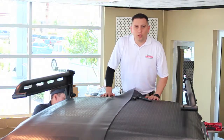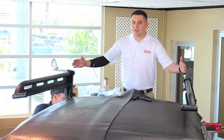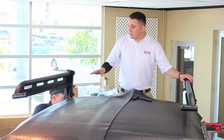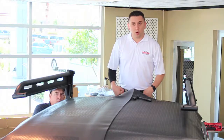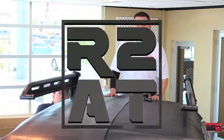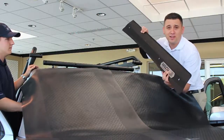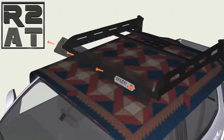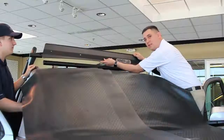This is the part where you want to make sure that you get both your roof rails lined up. You're going to do that by getting your rear corner braces adjusted. Once you get these bolted in, adjust the rear corner braces so you have a parallel line up front so you can put that front crossbar on. Next, we're going to get this beautiful fairing installed — it's got an awesome laser-etched emblem. We're going to put it in between the roof rail and the crossbar. Let's get it done.